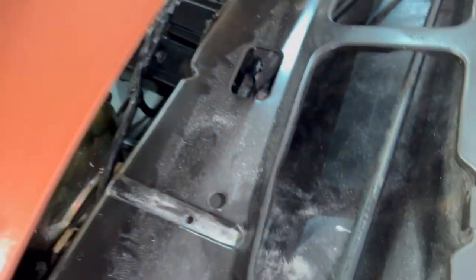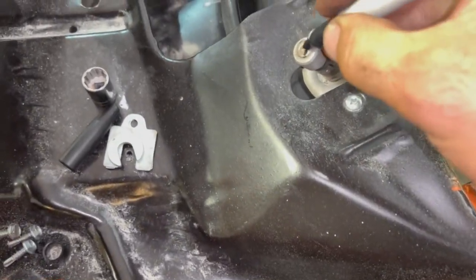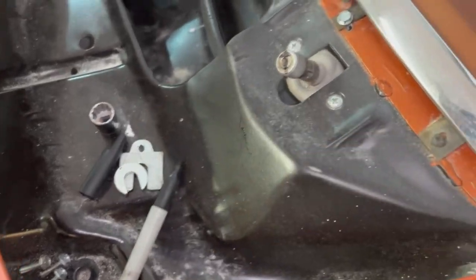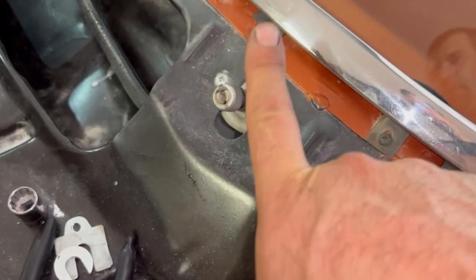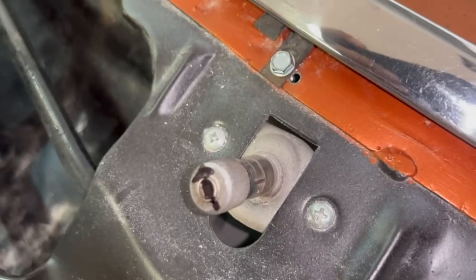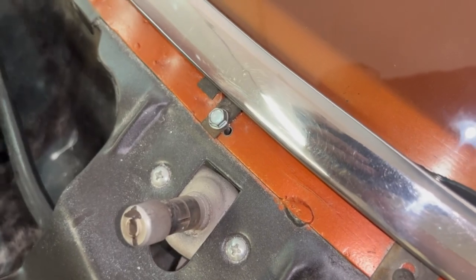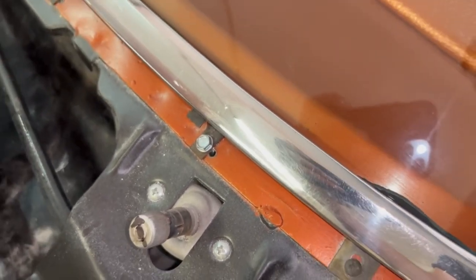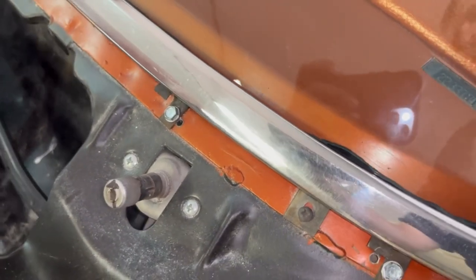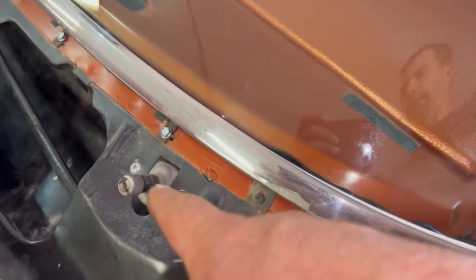To help visualize this, I'm simulating our wiper with an arrow pointing up. When I turn the wipers on, that arrow should point up further and then down if I got it right. Up, down, up, down — we got the direction right. Turn it off and it keeps going to park — back on — there's off. Yes, that is great. That's going to work just fine. I need to secure that nut, then install the cowling.